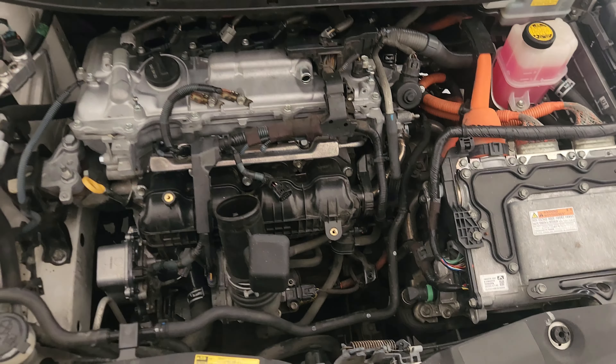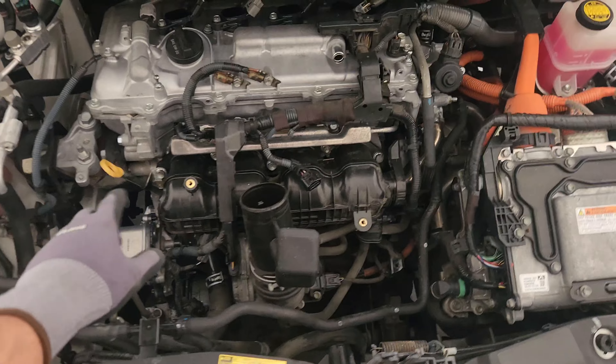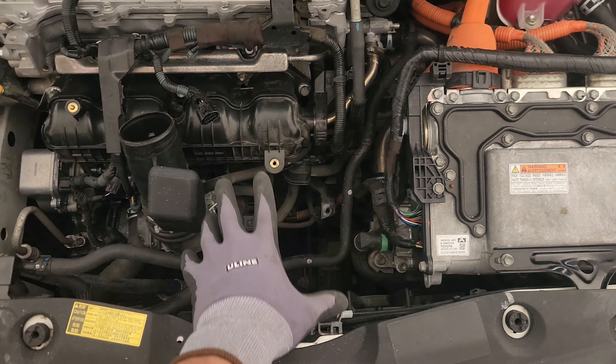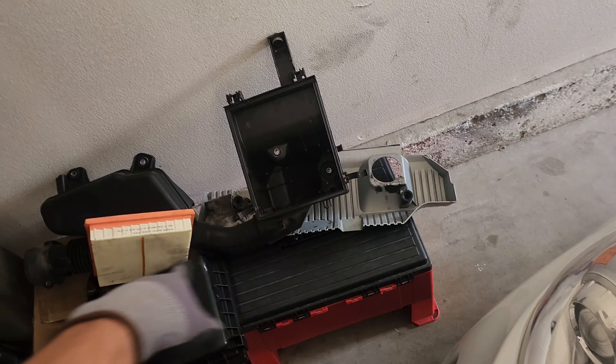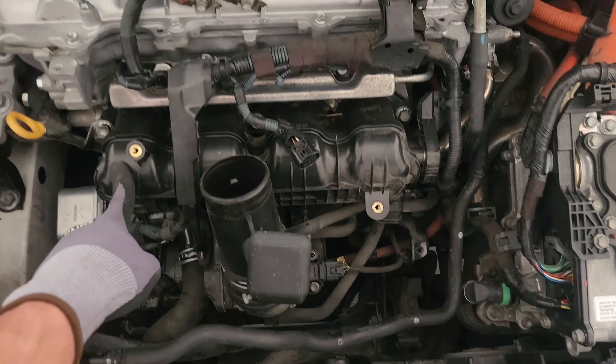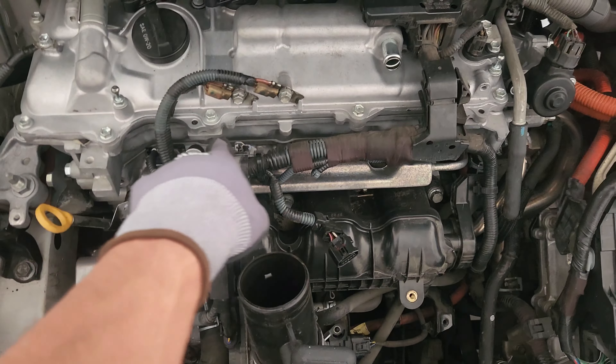So far with the update: I'm taking off the wiper blades and the wiper assembly following the A1 Auto video, and so far it's been pretty easy. I've already taken off the wiper assembly — it took me less than 20 minutes. I've already gotten into the engine coils and unbolted everything, so let's take them out and see what they look like on a 203,000-mile engine.